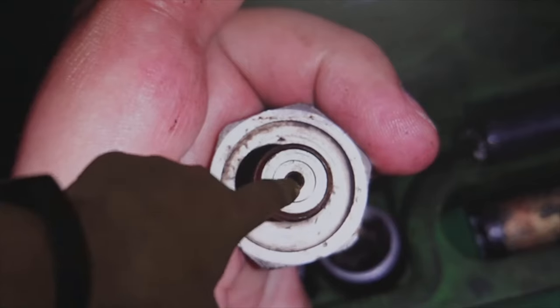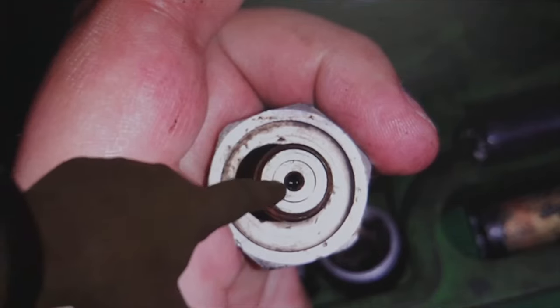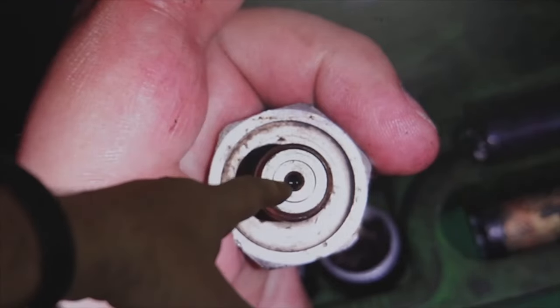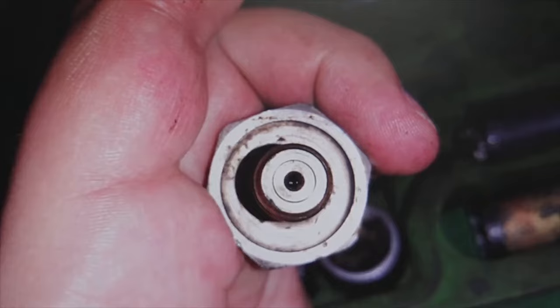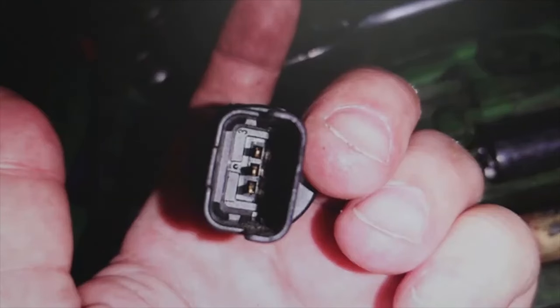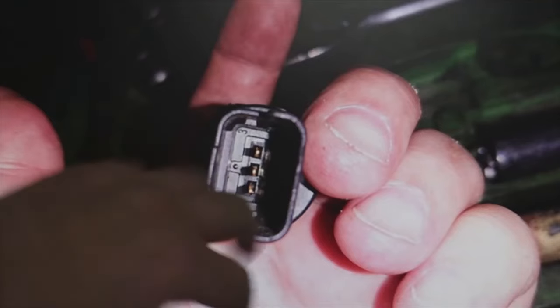Simply with a connector cleaning spray or a flow meter cleaner, you spray from the outside into the hole so that the filth and dirt inside comes out. If you use connector cleaner, take advantage of it and also clean the pins and the connector that goes to this part. Do that test, because sometimes the problem comes because there is dirt and the part does not work well. This part is not cheap, so it is worth doing that test to clean it before changing it.